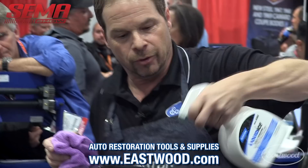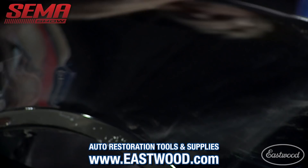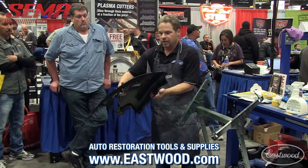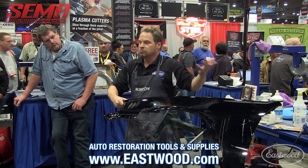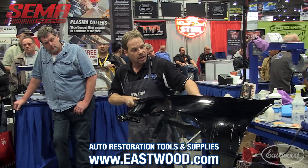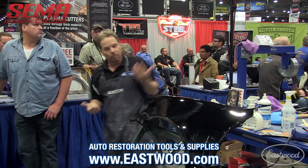This is a Body Shop Safe Detailing Spray — Norton has it as well, but you can get other products; 3M also has that type of product. You can see what we did. When we started out, this fender was really shiny and a perfectly acceptable daily driver paint job. But if you look at the difference in the gloss — straight down the side you see a little bit of chatter and texture, but right here it's like a mirror. We did a four-step sanding process and didn't burn through any of the clear coat because we used a guide coat to monitor our progress.